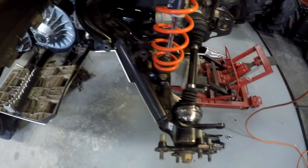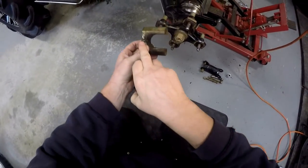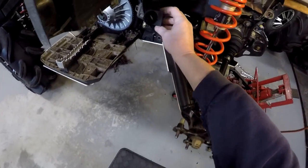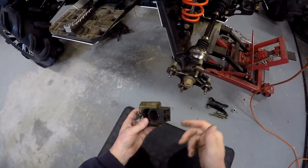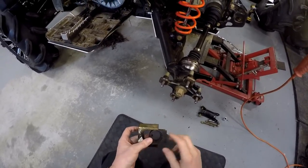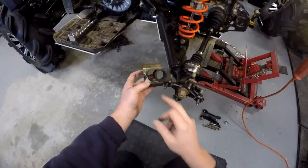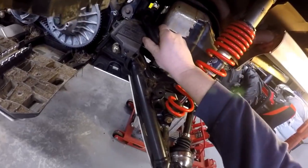You'd think there's got to be a lot of grease in there, but you'd be surprised. You put the grease in and it comes out here — there are two holes here, and this is tight on the sway bar. In reality there isn't any grease that goes in there; it comes in and just greases the sway bar a little bit. You'd be better off taking these off and greasing around with your finger every once in a while — that's why these don't hold grease.